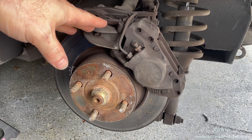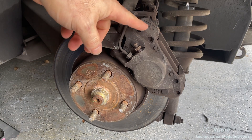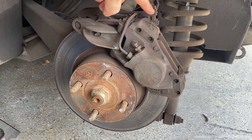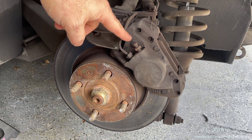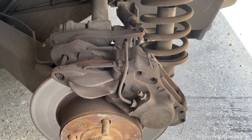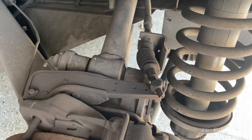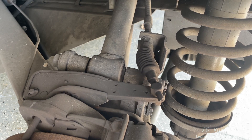Here's the whole unit — we've got the e-brake in the front with the regular caliper in the back. The e-brake's connected via this linkage; the cable comes in over here. Access to the top bolt necessitates the removal of the e-brake. I know my e-brake's not frozen but I'm going to test it anyway — first with the ratchet and let go, then without the ratchet and let go. We can see everything's working, there's no binding.